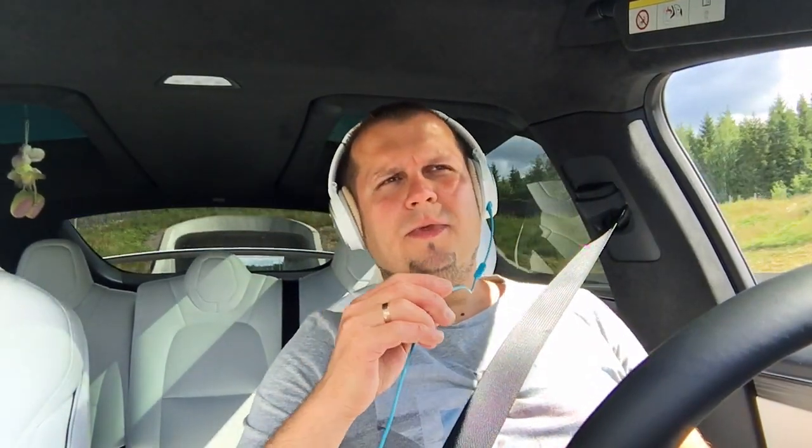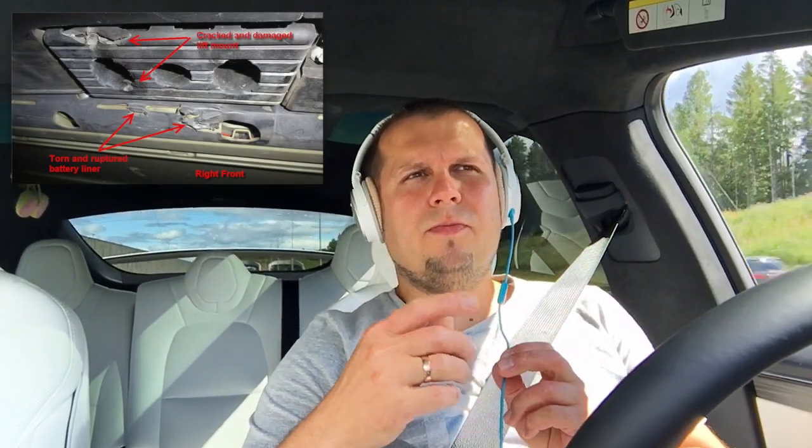Before, when I had the Model S without air suspension, I really struggled to not make any scratches around the jackpoint. It's a rectangular shaped jackpoint on every Tesla, and that doesn't go well with a round jackpoint on a normal hydraulic jack. Even if you use the rubber thing, it will damage the area around the rectangular jackpoint underneath the Tesla. So I strongly recommend to use something in between the jack and the underbody.